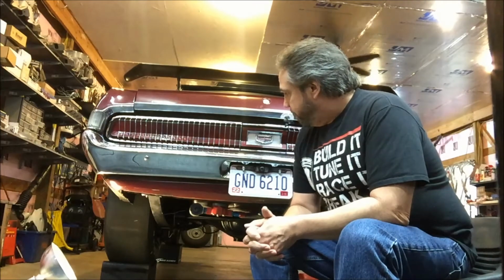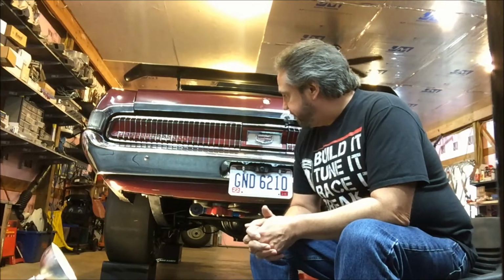I don't know how it worked out. It's one of those things that just works out. Sometimes you get lucky meeting people. But I think it's time to change. I think the spring's bent from doing a bad wheel stand. So I think it's going to be beneficial to get that out of there and put a new spring in there. The same rate, if I can keep it, because I like the way the car has for a stance.